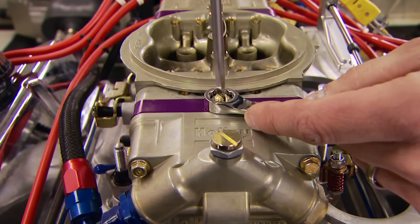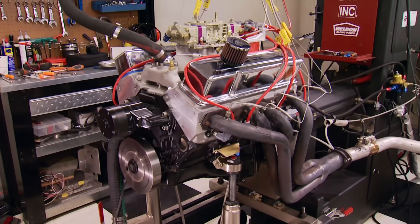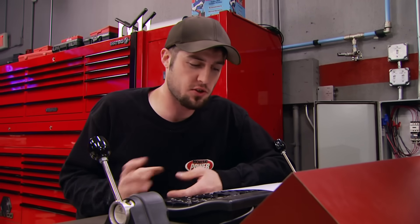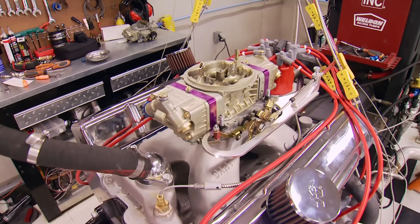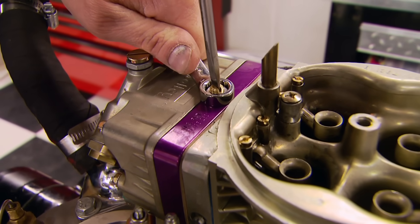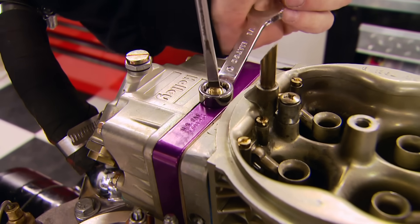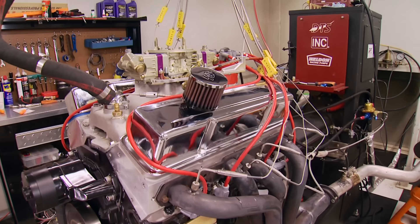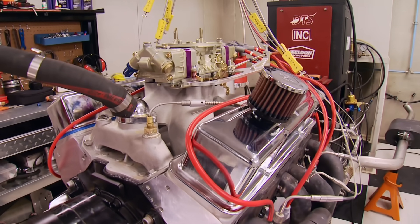The chart didn't account for engine mods like our heads and big intake - this thing is starving for fuel - so we'll open the metering needle up two jet sizes. Air-fuel ratios look pretty good to about 4,300 RPM, but the motor is using most of the air at wide open throttle and it leans out from that point on, so we're going to make another adjustment on the metering needle and dial it in a little better.